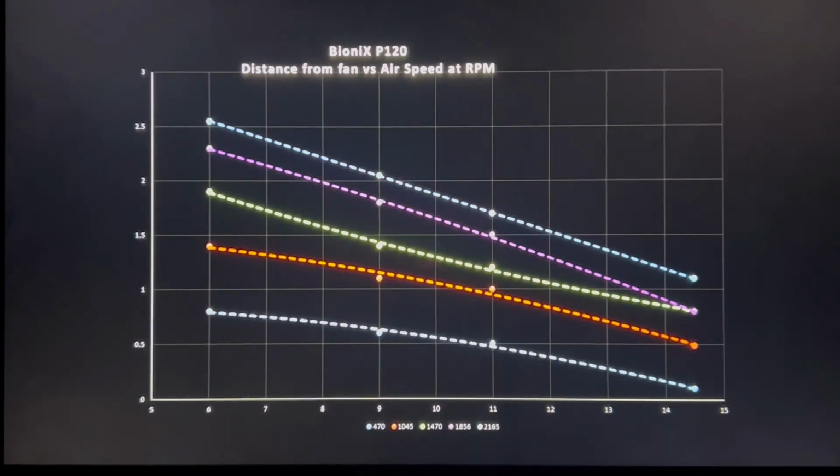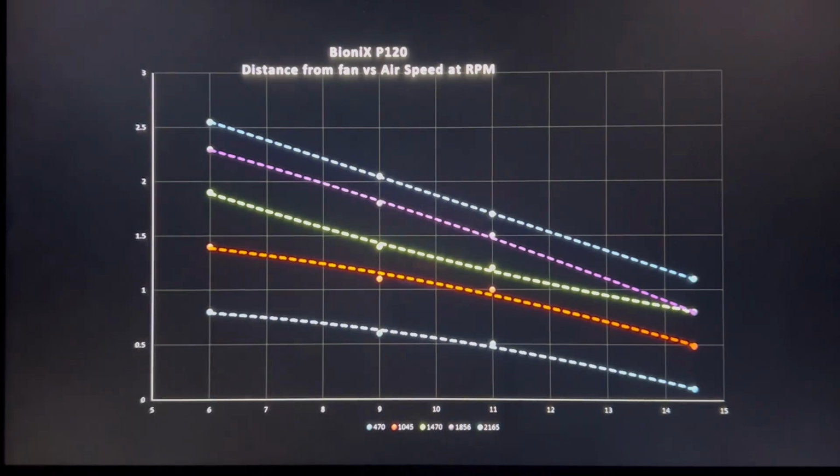For example, with the Fractal Design Torrent, the fans are all along the bottom, so they're actually blowing air directly into the GPU. So you're looking at the 6-inch mark for how effectively it can push air that short distance. Depending on where you plan on putting the fans is where you'd want to be looking on this type of chart. Specifically on this one, I took it at 20, 40, 60, 80, and 100% RPMs, and the other ones would fit somewhere in between them.